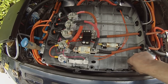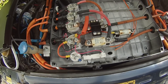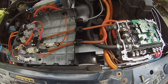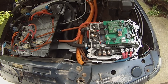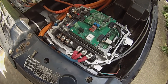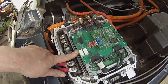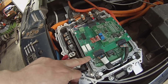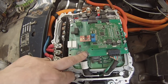That's pretty much our high voltage junction box done — there was a handy bolt in there that would have rattled around and shorted something out, so that's good. As I say, the Lear charger is in, and over here is our inverter for running the two motors. This is a Lexus IS 300h hybrid inverter with our open inverter logic board on here.